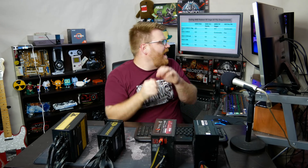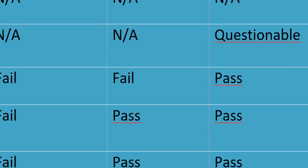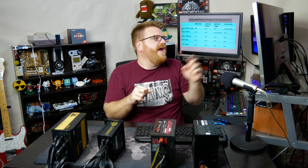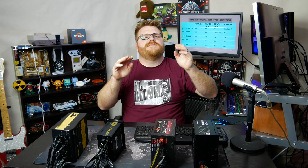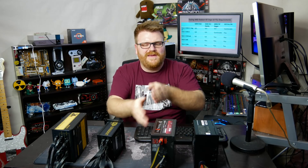The OCZ was getting a fail halfway through the second round of Firestrike Extreme on the Ryzen 1700 at stock. It would actually pass the six-core — the 1600 mockup I did through Ryzen Master — and it passed the 1500 config too. So with no overclocking on those CPUs, you could maybe get away with using a crappy power supply. I would not recommend it, however.